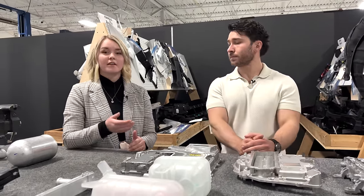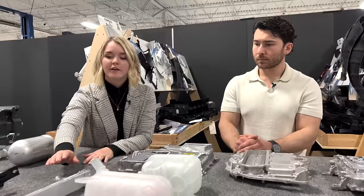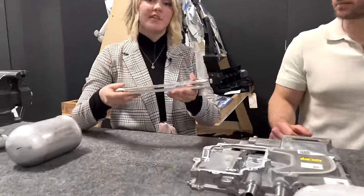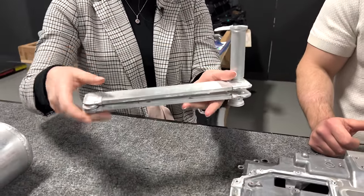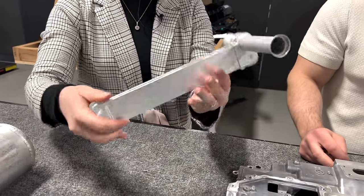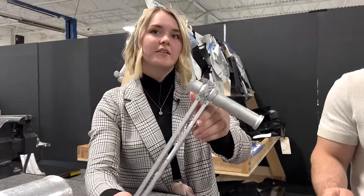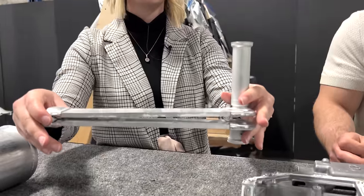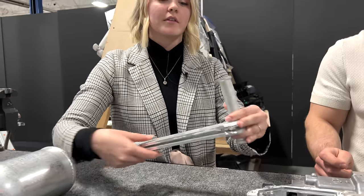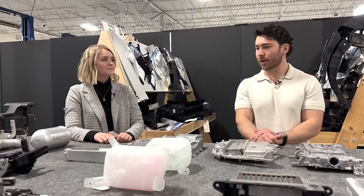Yeah, I'd say additionally, it is good to note that the front and rear inverter on the Ioniq were actually cooled in two different ways. This is the rear inverter here, and I've taken the coolant assembly from the front inverter in order to show you here. All of the IGBT modules were lined up within this channel here and then sandwiched in between both the inlet and outlet of this coolant channel, so that way they could get the most direct cooling possible. And you can kind of see a little bit on the edges, that white residue, that's all thermal paste. So they greased the entirety of the inside of these two coolant tubes and then sandwiched all the components that needed the most cooling together, so that way they had the most direct results possible. Right. And that is something that we actually saw on the F-150 as well in terms of cooling some of their electronic components. Great.